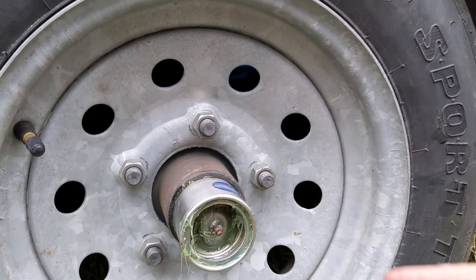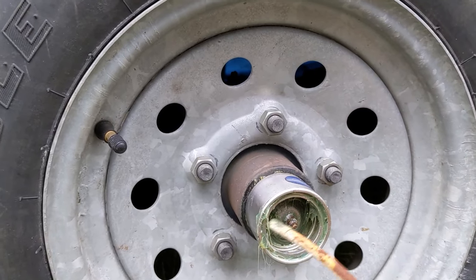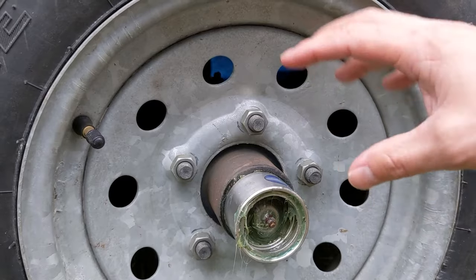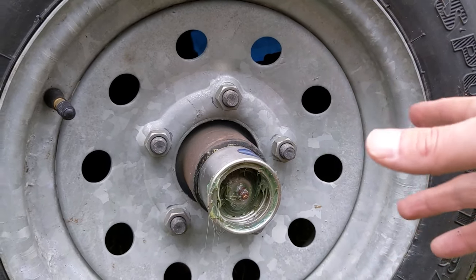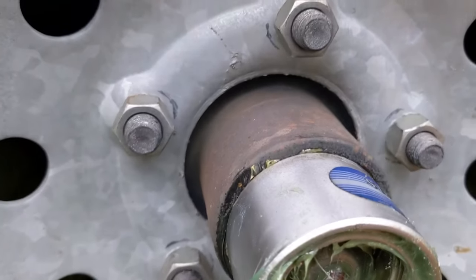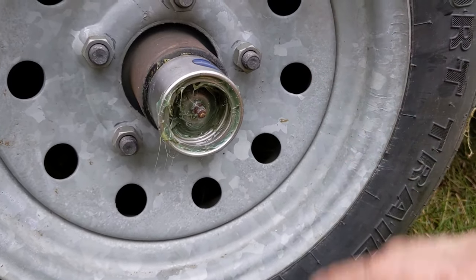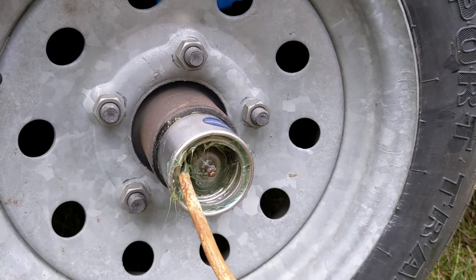One more thing - I have stainless steel bearing buddies on mine because this boat goes in the ocean. The proper way to do this is to not mix two different types of grease. I don't know what grease is in there, so what I'm going to do in the spring is take off the bearing buddy, take off the whole hub, get out all the old grease, and repack the bearings with my own grease. Don't put too much grease in there - this little metal seal ring at the bottom shouldn't be touched, otherwise you'll blow out your back seal. Just grease it enough so you can move it a little bit, but you want it to be able to move back and forth.